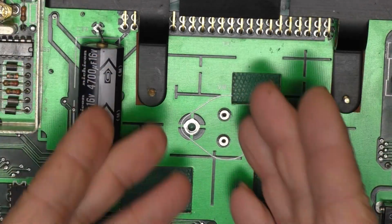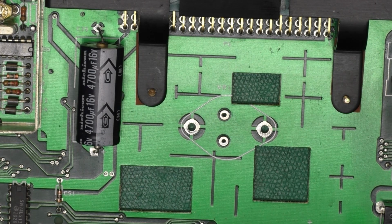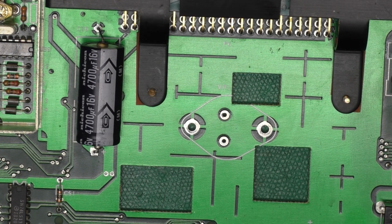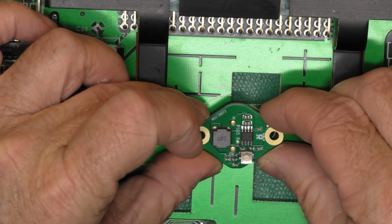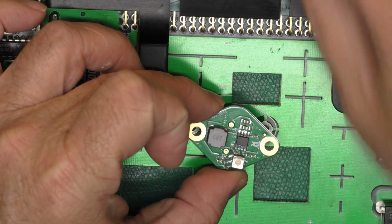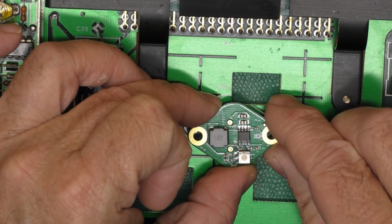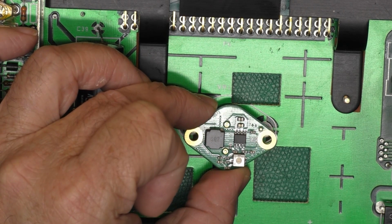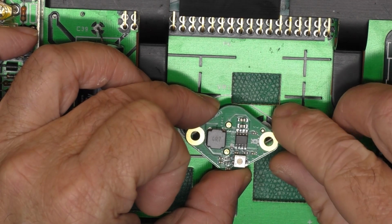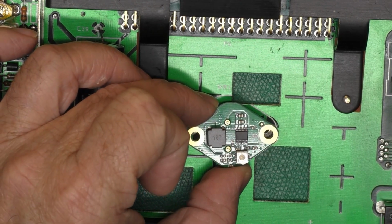The higher the input voltage in relation to the output voltage, the worse this is. But the nice thing about linear regulators is they're simple and provide a very smooth output. So what we can use instead is this little guy, which is a switching version of this. I found out about these from Chuck Hutchins. He did a video, which I will link to in the description below, putting one on his VIC-20, and I thought it was an excellent idea. These aren't too expensive. And, rather than 40 or 50% efficient, these guys are more like 80+% efficient. So we're going to generate very little heat.